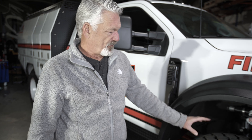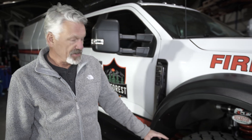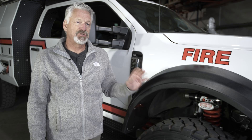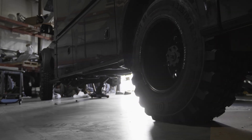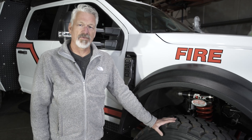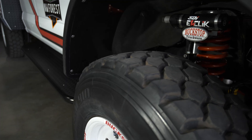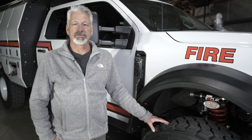We're really excited to have found a new tire on the market. Buckstop is importing the Petlas RM910 tire. Up until now, choosing a tire was a series of compromises — you've got to choose between noise, speed, weight rating, availability, quality, all these different things. We think this tire checks all the boxes. It's got an 81 mile-an-hour speed rating, it's quiet, it runs really true, it's very round, and it balances out extremely well.